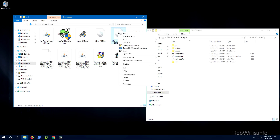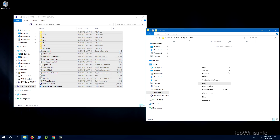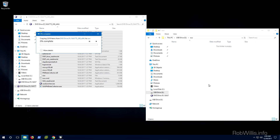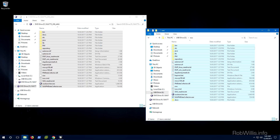The next thing is to take our SUU image that we downloaded earlier. Since I'm on Windows 10 I can just right-click and mount it, but if you don't have Windows 10 you can use something like 7-Zip to extract that ISO image. I'll select all of the files from the SUU image and copy and paste them directly into the SUU folder I created on the new bootable USB drive. This image is huge — around 10 gigs — so it's going to take a few moments. To recap: we created a bootable USB drive using the live Linux image from Dell's website, then mounted and extracted all files from the Server Update Utility image and copied them into a folder on that same bootable USB drive.